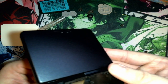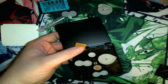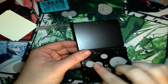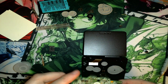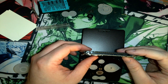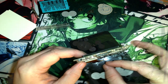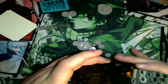I've got all that — I'm going to hold that back and put your screw in there. Make sure all your pads and stuff are nice and pressed on there, and you've got your ribbon cable. Once you've got all that, take this and reconnect it — be gentle. You don't want to rip the ribbon cable because then you're pretty much screwed. Finally, after a lot of battling, I got it in there.